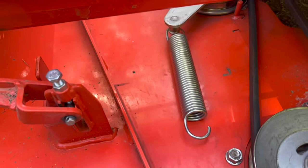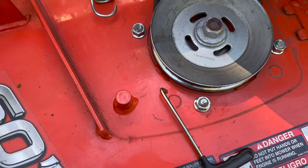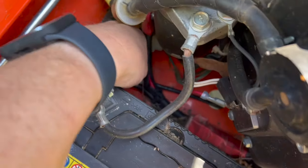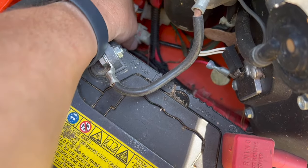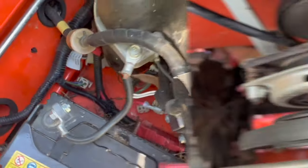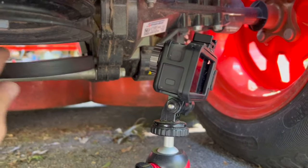Again, that tool — if you don't have one, get one or make one. Now this is the clutch cable; just gotta squeeze those clips there — got it disconnected. Now the tension's off; this just pops right on down, get it out of the way.